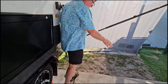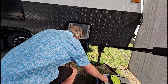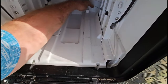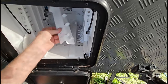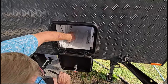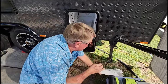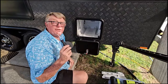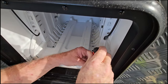The first thing we need to do is remove the cassette toilet - we'll put that out of the way. On each side inside there are two long pieces, and what we need to do is just lever them out. These have been out a couple of weeks ago so they came out quite easy this time - a little bit harder the first time. They're only held in by clips, one each end, and they just pop in. That was the use of the knife. Now with the Phillips head screwdriver, there are six screws to remove - two in the front, two in the middle, and two right up the back.